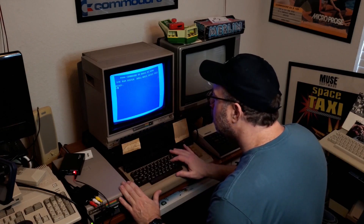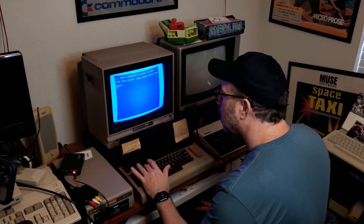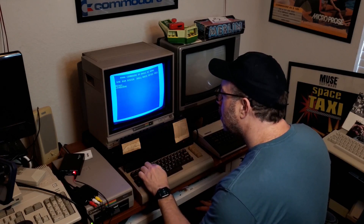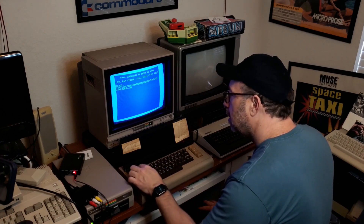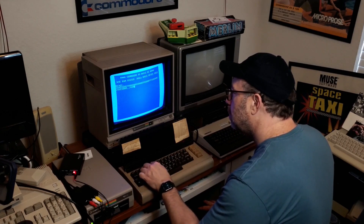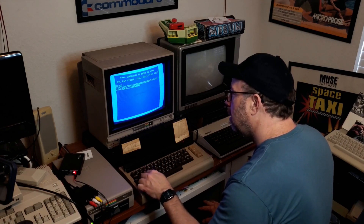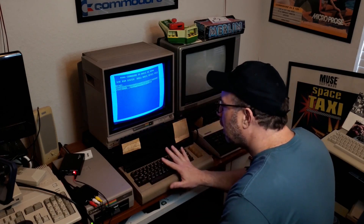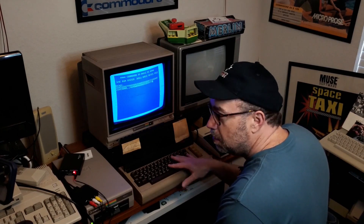Let's see if we can do any kind of commands. The A key is not working and the keyboard is not working all the way — something's going on. It's hit and miss with this keyboard. The 2 key no matter how many times I hit it is just not working. A is working a little bit better. It's got to be some dirtiness in there. We're going to have to open this up and check out the keyboard. Luckily I have a bunch of Commodore 64 keyboards, so let's try another keyboard and see if it works.